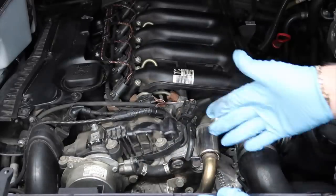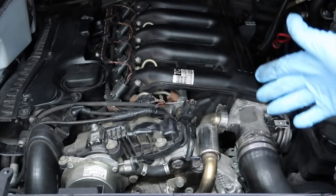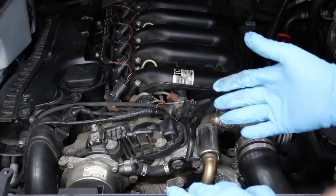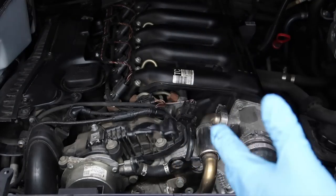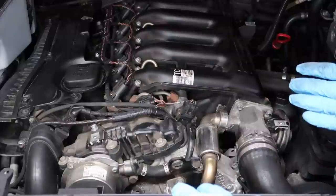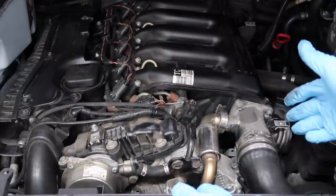I want to get rid of the EGR system. As you can see, it's got a pipe that runs back to the exhaust manifold and we're going to be blanking it off as well, because when you want to service this car this is just completely in the way and there's no need for it. All it does is send the carbon deposits back into your manifold to be burnt off. This is a matter of opinion — a lot of people believe in keeping it because the exhaust gases are good for the engine.